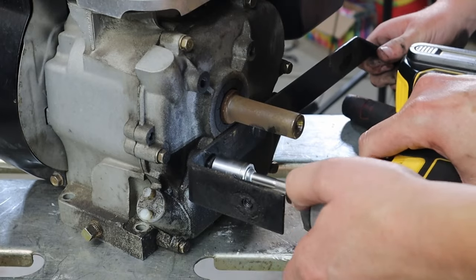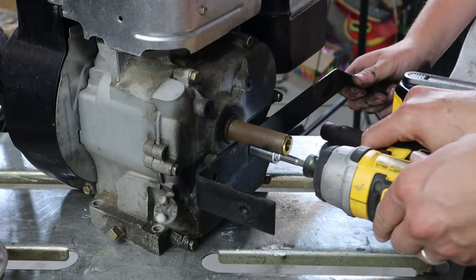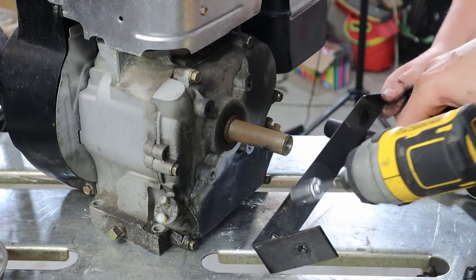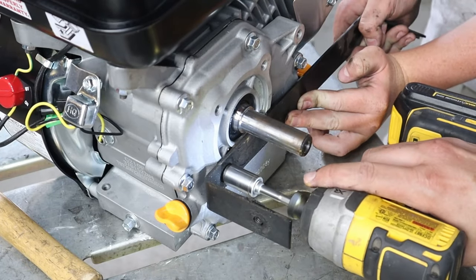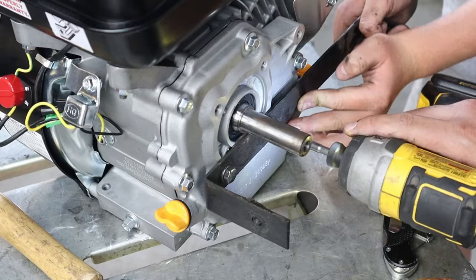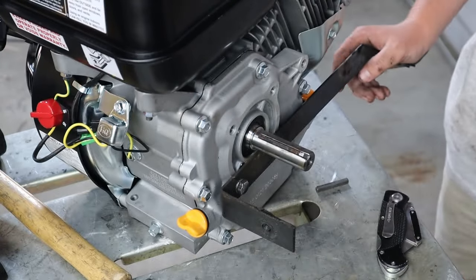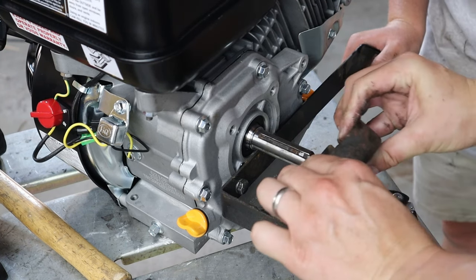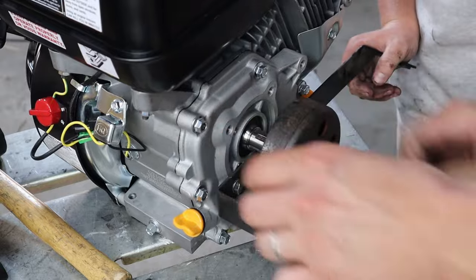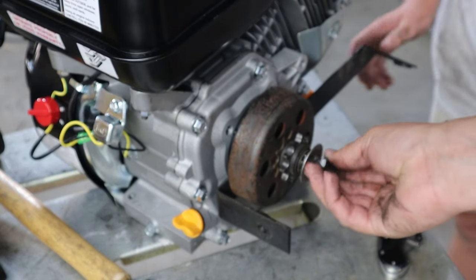This little bracket is for the chain guard, and if you get a similar size engine it should have the same mounting holes as before — luckily this one does, so we're already into reassembling everything back onto the new engine. A lot of these little centrifugal clutches, which you can pick up on eBay or Amazon, already come with a key built in, so you don't need to use the one that came with the engine.